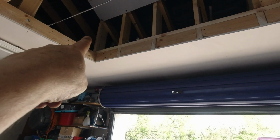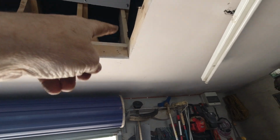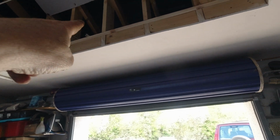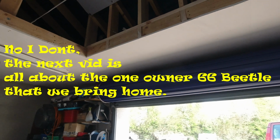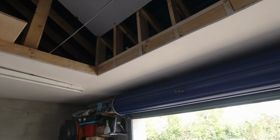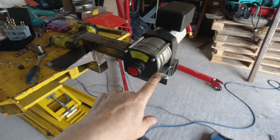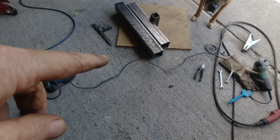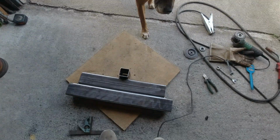I've got a 7-foot long round iron, 20mm, so that's 3/4 of an inch by 7 foot long, and I'm going to drill up and put that bar through all of those timbers, and then I'm also bracketing each timber with an angle bracket, and I'll show you that in the next video probably, so I'll get back on here again. And then I'm going to put a pulley just up here, or a shackle, and then I'll be able to come up and down to the floor here. So I'm thinking body offs and engine lifts, etc., stuff like that.